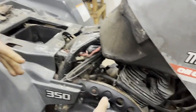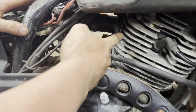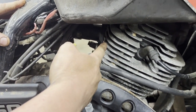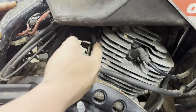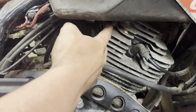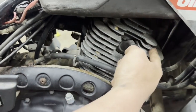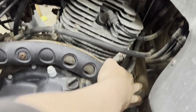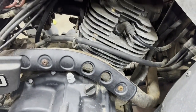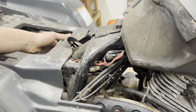In this instance, it is blowing on the palm of my hand, which tells me we're having trouble with our valves. Your valves are located in your head. On the carburetor side, it's considered an intake valve — it is blowing out the carburetor side, which is the intake side. On the opposite side of your head is the exhaust valve, which goes into your muffler and out to the back side of the motor.